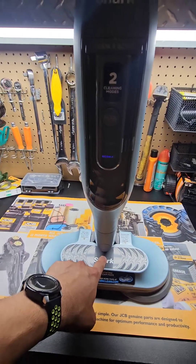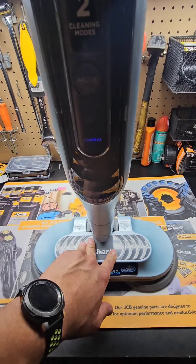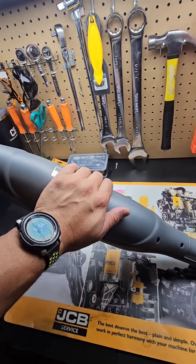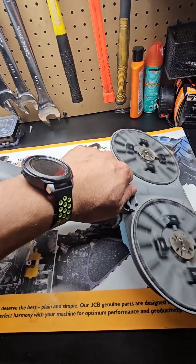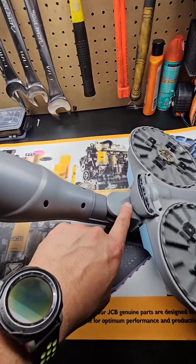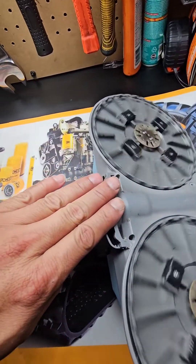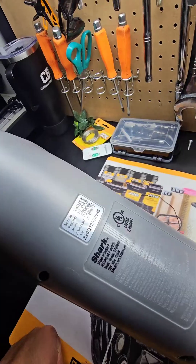You gotta rotate this back so that it activates the actual motors. I just leaned it back and I can feel right here that it's getting pretty hot - actually really hot. There's a little bit of heat coming out of here, but not that much. So most likely what that means is there's a clog right here. It has power, everything's rotating, it's getting really hot, and I can feel a little bit of heat coming out. So there's something clogged in here - that should be a simple fix.